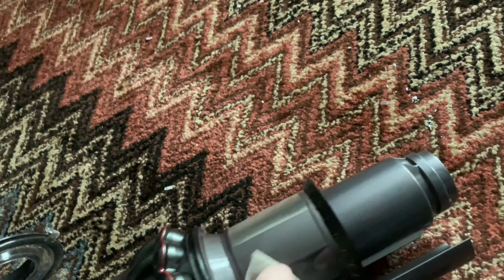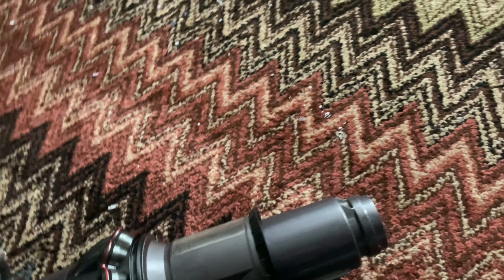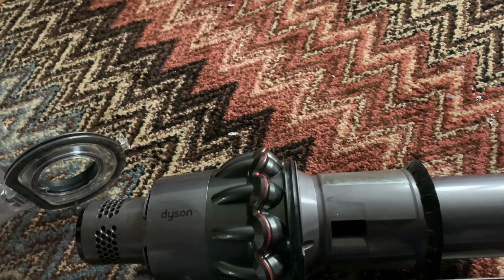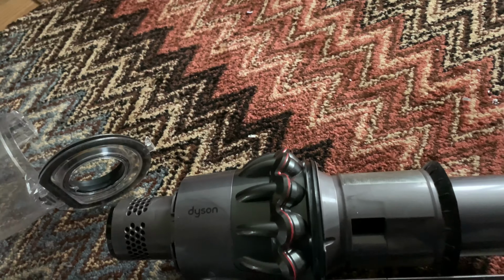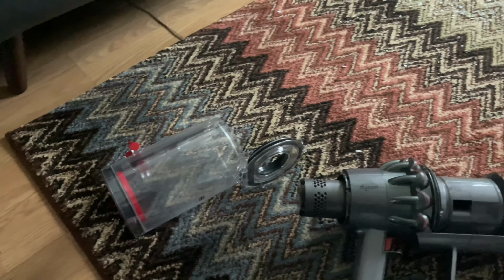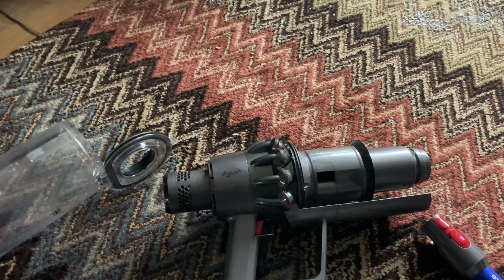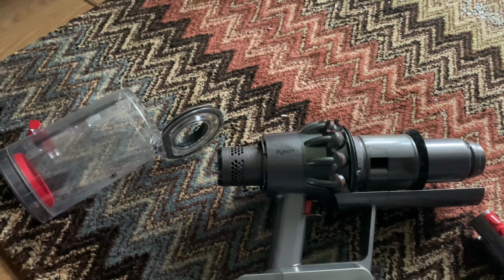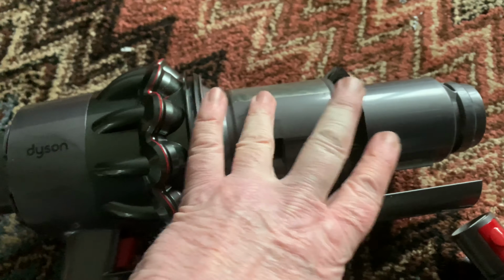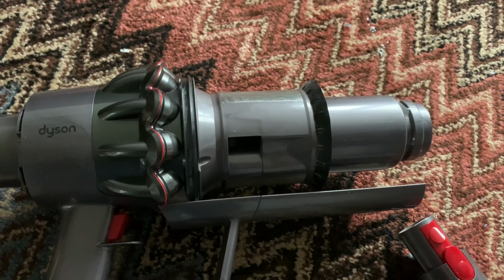It shouldn't be like that, because at the end of the day, with a bag machine, you replace the bag and it's nice and fresh inside. When you wash your filters, if you've still got your dog dander and stuff like that, you're still going to get the smell. So just by wiping this one out maybe once a week, or weekly or monthly. I do mine once a month when the filters are getting cleaned, because my house is not as dirty as other people's houses. I would recommend, if you're going to do this, to let it dry for at least 3 or 4 hours. So we'll come back and I'll show you the little trick.